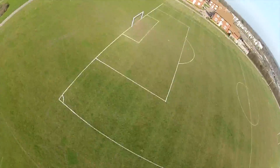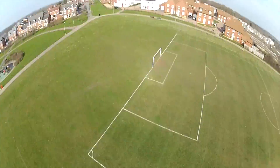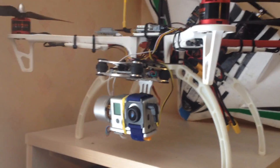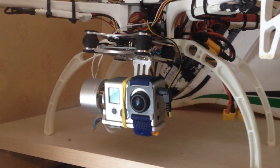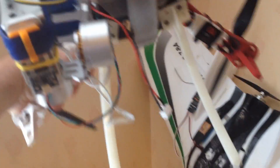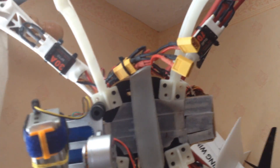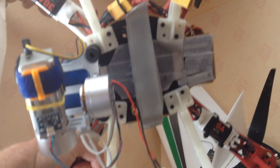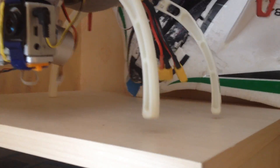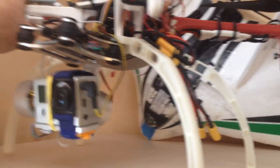I'll go through the changes I had to make, because I flipped that arm over. Here's the quad, and here's the landing gear on board — you can see it's pretty much a bit of a crab. This is because in order to get the battery underneath, I had to put it as was designed to go on a 550 rather than a 450, so as such you have to be quite careful with landings that it doesn't topple over.